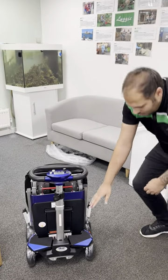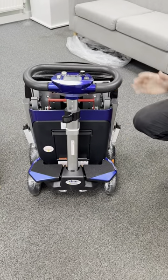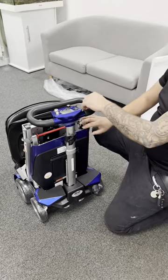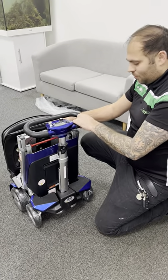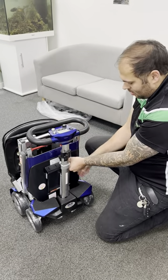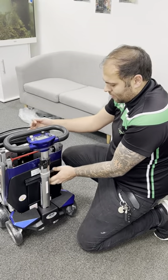On your battery — which is placed here — there is a little slip. The best way I can describe it is like a plastic grip in kids' toys that stops the batteries connecting. Grab the strap where the battery is and pull it until the battery pops out. Lift the battery up slightly and pull out that little plastic bit that stops the connectors from connecting.